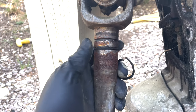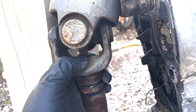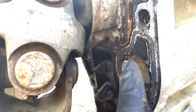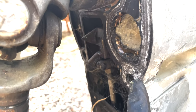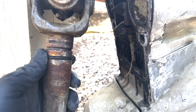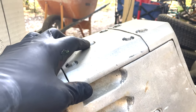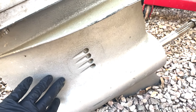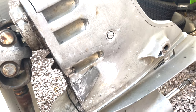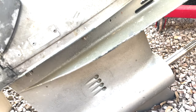We've got an issue with the gaskets, and this shaft here is kind of rusted overall. We've also got some zerks on these u-joints — you can see one right there. We need to clean this up. The sealing surface is all kinds of nasty. We need to make sure the gear shifter goes up and down properly, that we've got all the right seals before we even try to install this, and I'll double check the oil in here — I think it's dry but I can't be 100% sure.